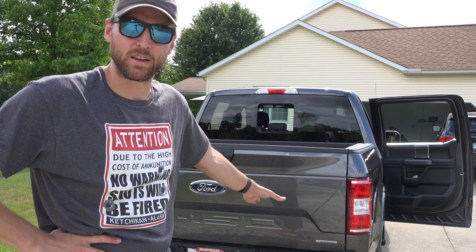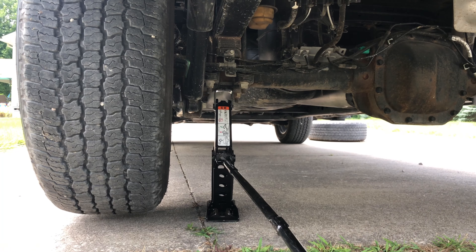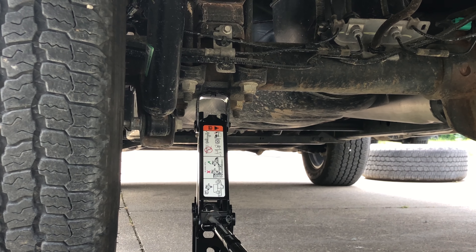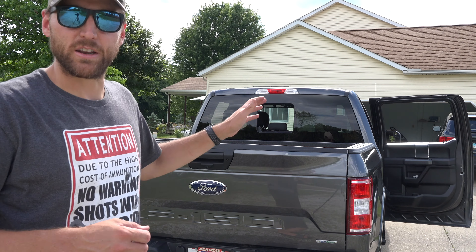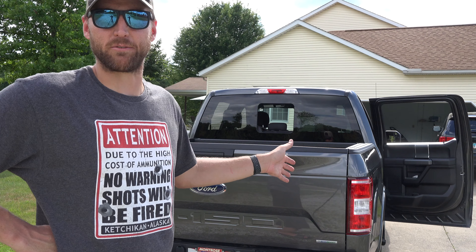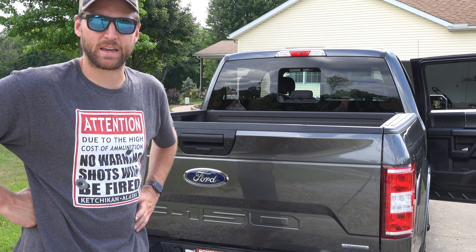The lift points on the back are right in line with the axle on the tire. Put the jack perpendicular to the axle, sliding in from the back — there will be a little slot and you'll see it very easily. Loosen the lug nuts on the tire slightly before you jack it up off the ground.